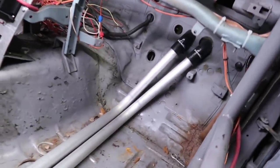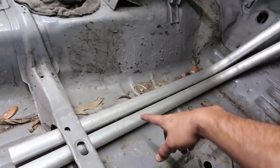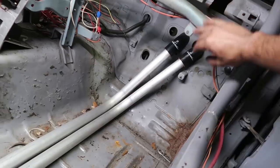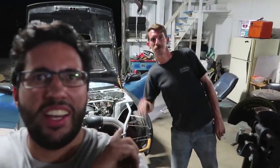To be legal in most competitions or even just for safety at bigger name tracks, the coolant lines have to be sealed twice — not only on the pipe itself, but again in case the pipe ruptures. Most people use AN lines, but those could break too, and the couplers could break as well. So we have to cover everything — the whole run, all the way to the back. Anything inside the cabin with the driver has to be covered. That's going to be the end of this video. I've got to wait for more couplers, redo my wiring, do the firewall, and then the car should be ready to go. Big thanks to Arthur from Bell Raceworks — go check him out, he makes seat brackets, e-brakes, shifters, diff braces, and all kinds of cool stuff. Link is below. Thank you guys for watching!